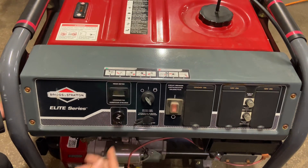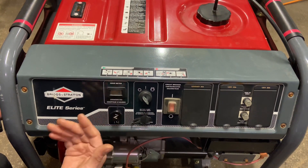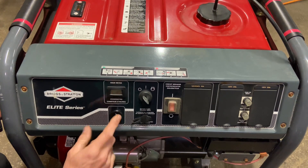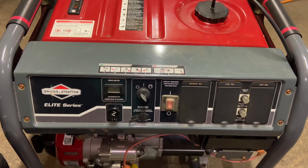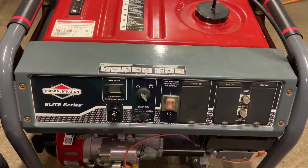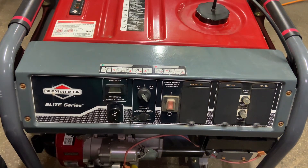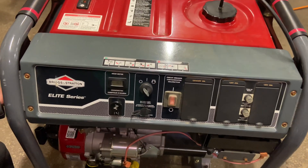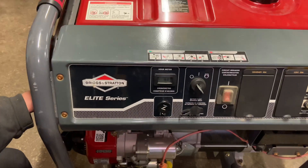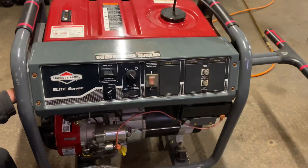If it keeps hunting and surging, pull the choke out a little bit, but ultimately the choke should be in when the machine is operating correctly and it should be smooth. I hope this helped a lot of people as far as starting a machine up. If you have any comments, feel free to leave one below. I appreciate everybody watching my videos — thanks for watching and please subscribe.